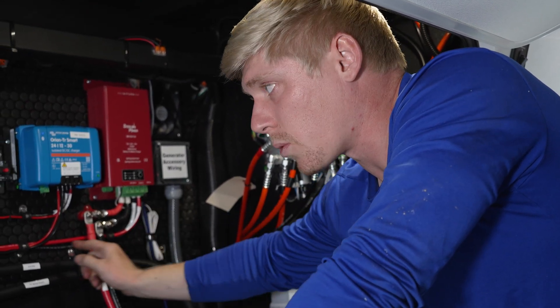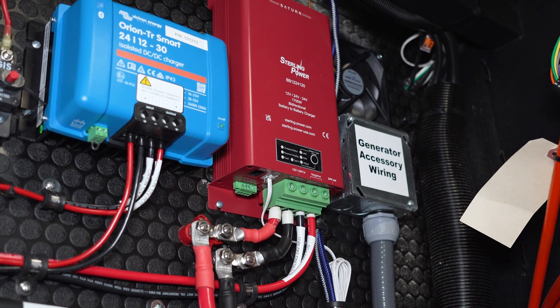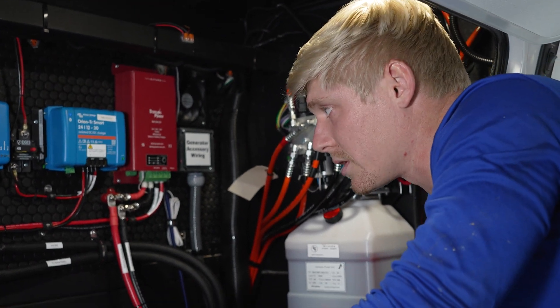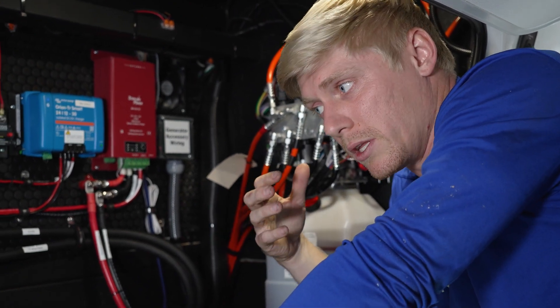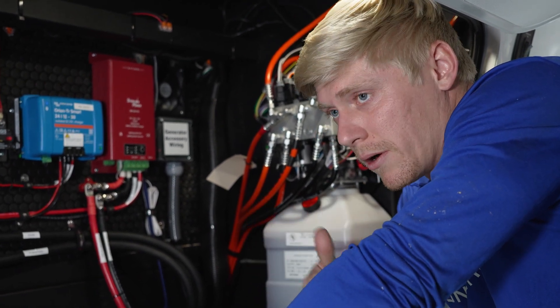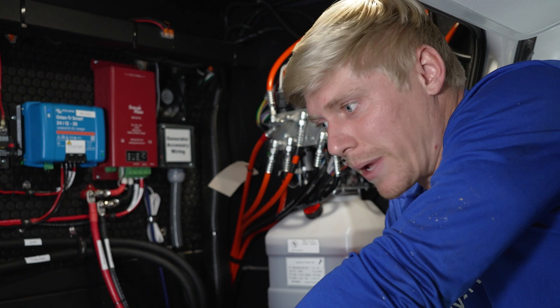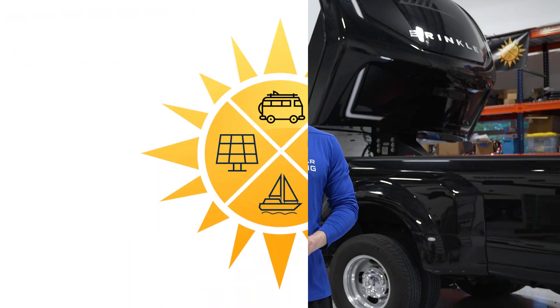This is charging a 24 volt battery, so we don't need nearly as large wires on the output. This is the Sterling BB1224120 — you can find these on our website and we may even have open box units available at a discount for budget hunters. This is a 1700 watt charger, triple the output of a Victron Orion XS, which is why we prefer these when powering a big trailer like a fifth wheel. We don't want you to drive eight hours to your destination and still have your battery only at 25% — this is charging faster than an air conditioner is using power. If you need help getting the right parts or an installation of a DC-DC charger on your fifth wheel, please reach out.